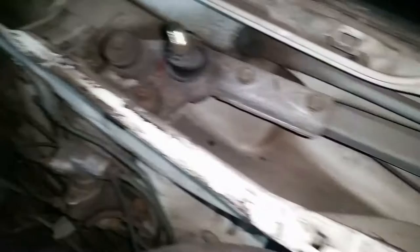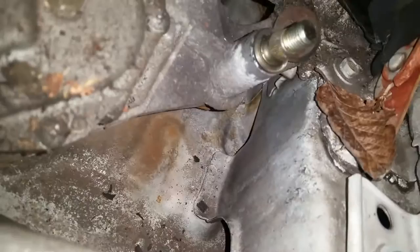The cowl is loose and I've turned the mechanism on so you can see it. From the motor there's one line going to here, and that's powering the center wiper — that's the one I'm going to keep. Then there's another one going from here all the way to there, and that's powering the second one, which I'm going to remove to save some weight.